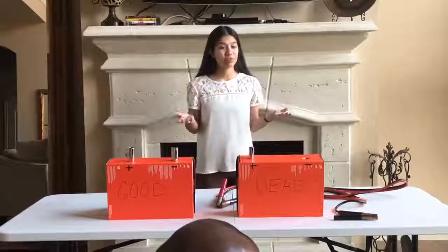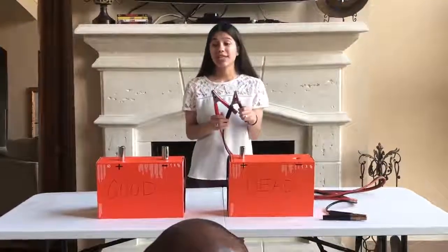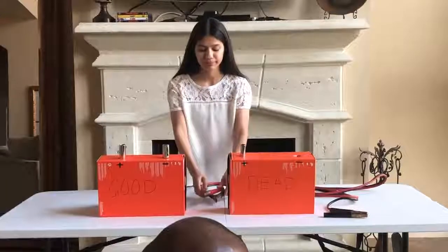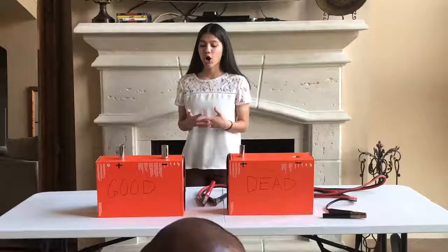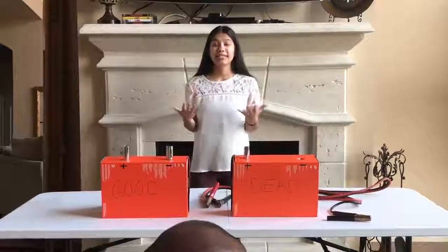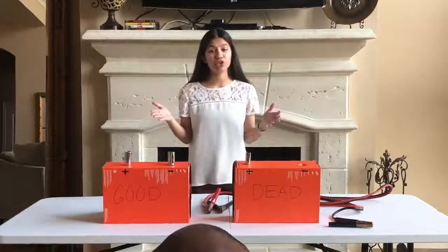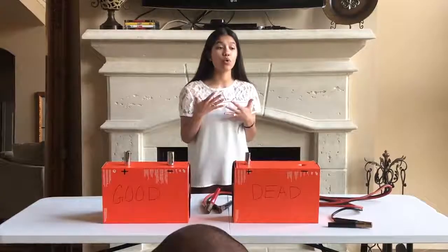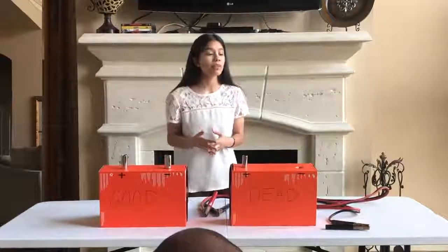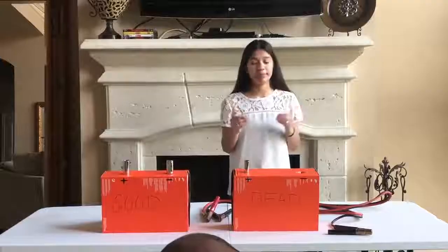The first step in jumpstarting your car is having the right equipment. The most essential piece is the jumper cables. They cost anywhere from $10 to $15 depending on the type that you get, and you can buy them from almost any major retailer. According to Meineke.com, a car care company that specializes in automotive repair, in their Choosing the Right Jumper Cable section, while longer cables may be more convenient, they are not always the best option because the energy has further to travel, which will make the jumpstart process longer or more difficult. In addition, cables come with a gauge, which is the strength of the cable. A good gauge to go for is a 6, and you also will want thicker cables, which will help insulate.